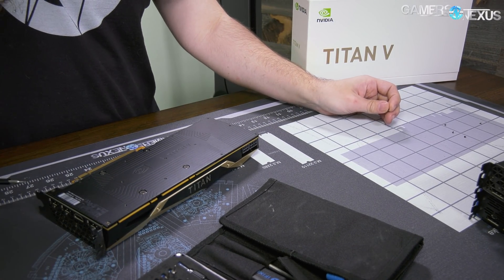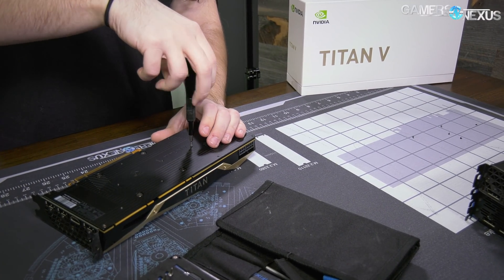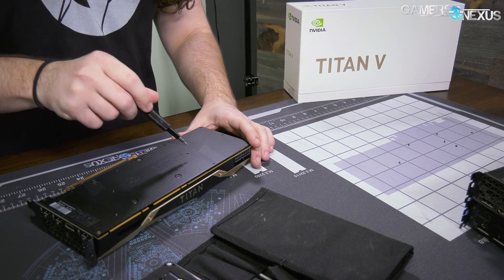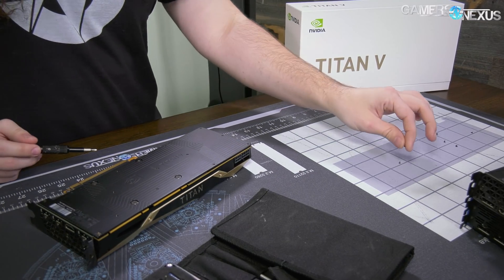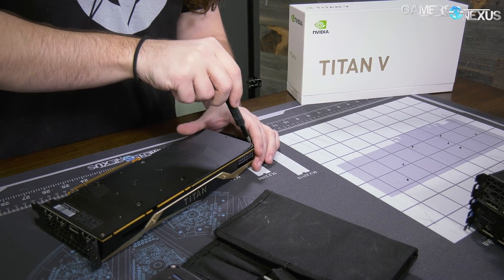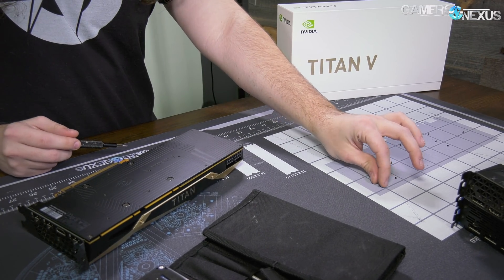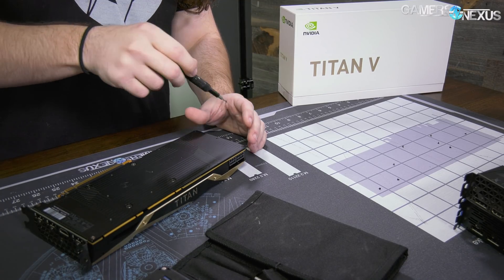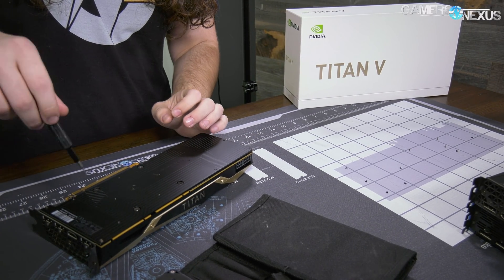This back plate is held on by a bunch of tiny screws — we've shown these before. The trick to these when you put them back on is to be very gentle. You do not need much force at all. Tighten these back on, and as soon as you face resistance, stop immediately. If you keep going it will snap the screw at the stem at the screw head — so we don't want that. We've done it before.